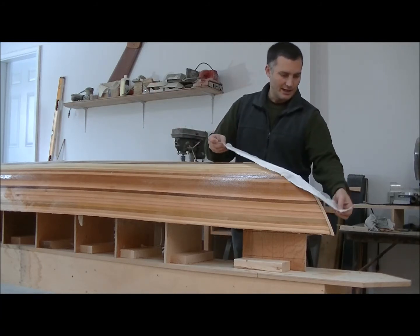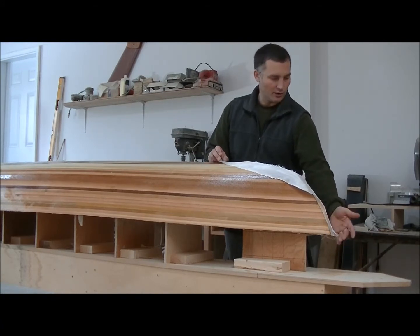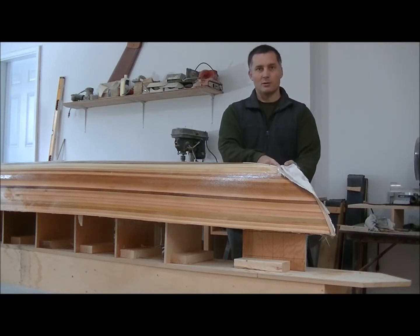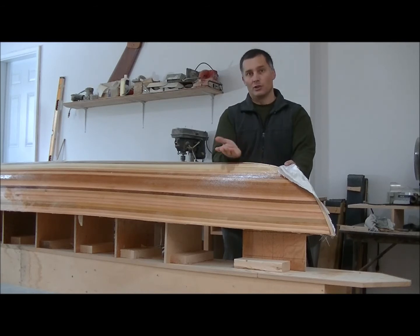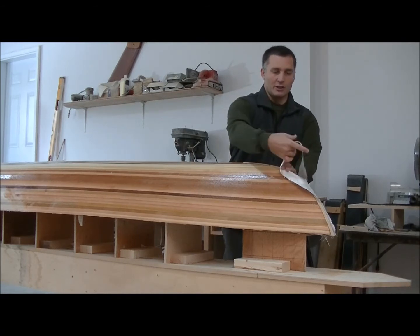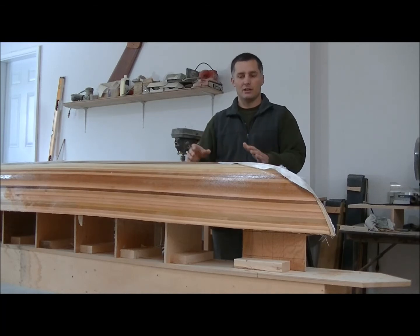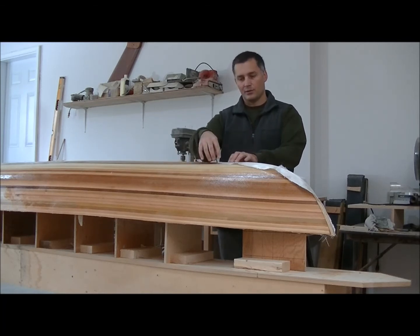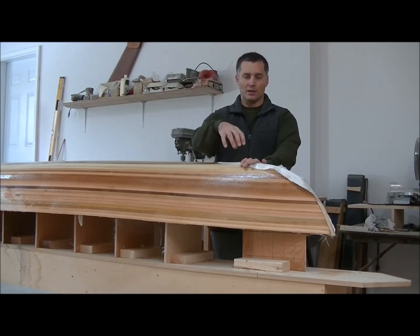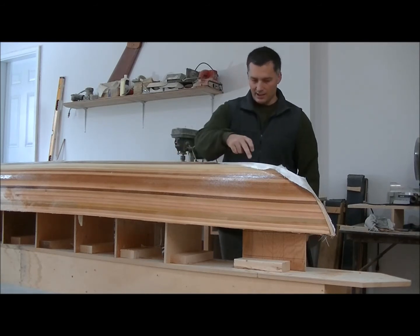So I'm going to lay that in place right now, and you see that the length, you've got to make sure that you have enough to go from the stem at the shear line up to where you trimmed your fiberglass, okay? Or a little bit above, an inch above would be fine. Okay, I'm actually going to go a little bit further, and I'm overlapping all of my fiberglass. The reinforcement area ended around here, so I'm going to have about 4 inches where there's actually 3 layers of fiberglass.